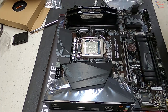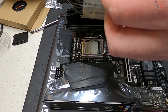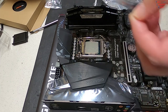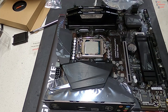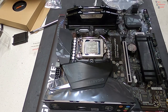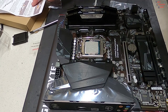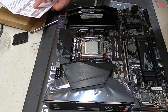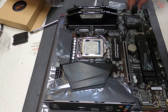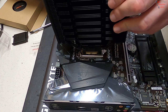The ever-important part: removing this clear plastic protective cover from the cooler base — do not forget to do that. Then we want to be sure the Be Quiet logo is facing the correct way when we place this on the board. We'll take the bracket out and gently set our cooler on our processor.